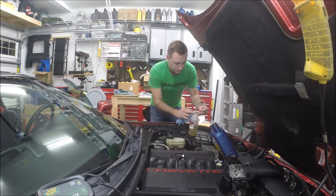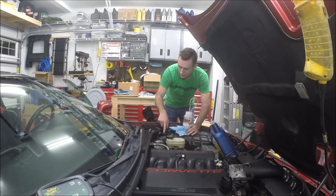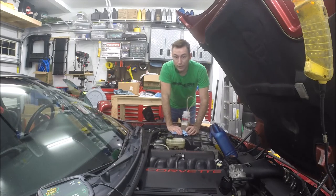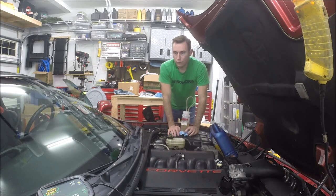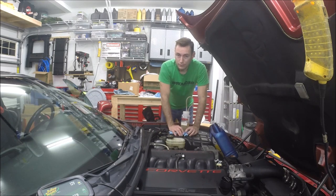With this speed bleeder, changing the clutch fluid or bleeding the system becomes easier than doing an oil change, because I ran the bleed line up here right by the reservoir — it's really easy to get to and it's a one-man job. Obviously it would be difficult to install one of these if you're not doing a clutch, but if you are doing a clutch, absolutely install a new slave cylinder and absolutely install one of these remote bleeders. It makes life so much easier, especially if you use your Corvette for performance driving, autocross, or road course work. Being able to change the clutch fluid is just part of your regular maintenance. I highly recommend one of these — probably the best 50 bucks you'll ever spend on anything related to your clutch. Hopefully you found this helpful. If you have any questions, feel free to ask in the comments, and as always, thanks for tuning in to Scruff's Garage — we'll see you next time.